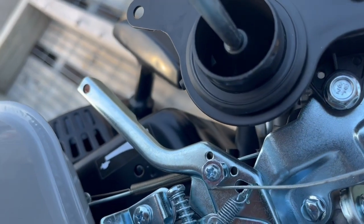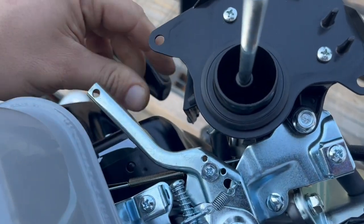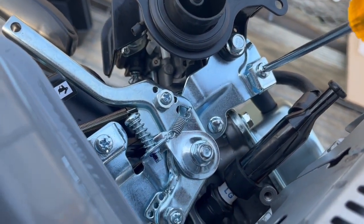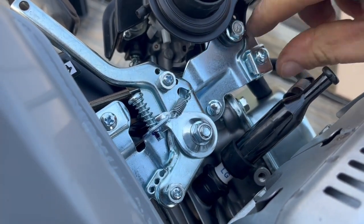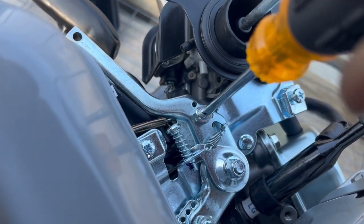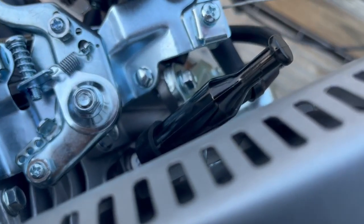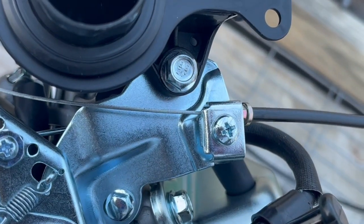They don't give specific instructions for the throttle cable, just the generic motor manual. Twist off the top cover, pull the wing nut on the foam filter assembly, remove the filter assembly, and I plan to run the cable through there. There's a little nut with a place to run the wire through - crank down on that to lock it and actuate the throttle the way we want. Loosen that area first - that's what we're going to run the cable through - and keep some of the zip ties on, then run it right through.